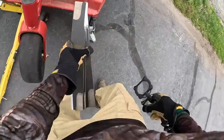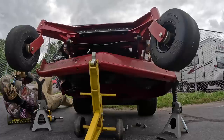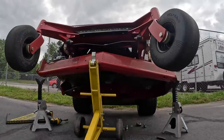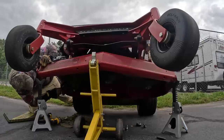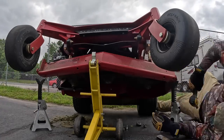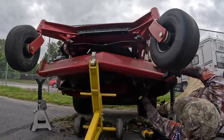All right, let's go ahead and get them installed. What I like to do is — because this Toro Revolution has two little guide holes — you place the blade into the guide holes and kind of tighten it up. Now here I saw that I needed to clean the deck, so I'm just scraping the deck off and cleaning things up. All of this was from yesterday — it had rained in the morning so everything was kind of wet. Just cleaning the deck off real quick before I install the other blades.